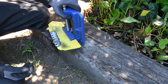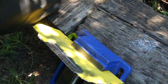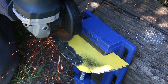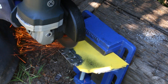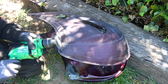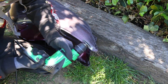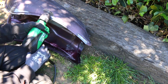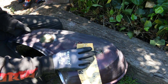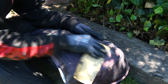I almost cut all these tabs off without removing the paint first, which would have been a lot harder — it's easier to just blast off all the old paint when it's one piece. This was a panel I cut out from one of my old e-bikes; I always keep a lot of scrap metal because you never know when you'll need to make tiny little tabs. You can see I'm stripping the paint off where I'm going to be welding the tabs on. Yes, I'm welding more on this gas tank, but this area is not as daunting as the thinner parts in the middle of the tank, so I'm not too worried. I also filled the dent and the recesses for the badge attachments with more of that epoxy tank bond, which actually sands pretty well.